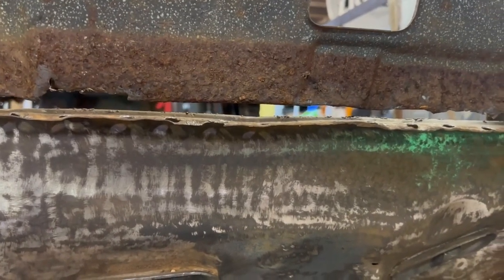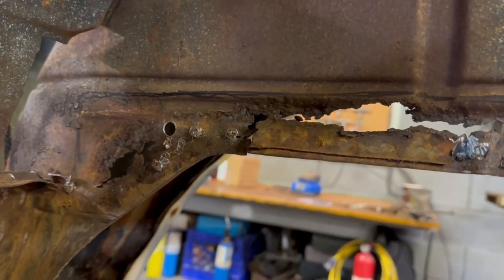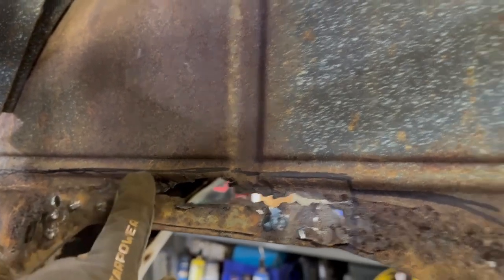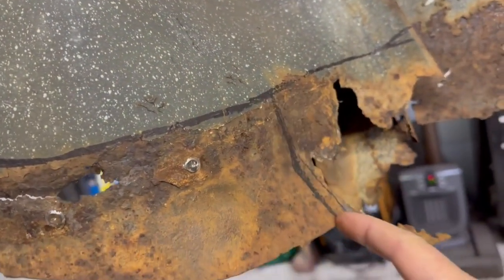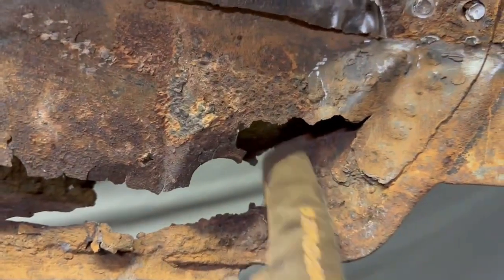That's step one. Then we get into the rear wheel wells. I'm really trying to save what I can here — bordering on automotive archaeology. You can see I've drawn a line here where I intend to cut. Each one of these will be a separate piece: I'll put a little curl in it and try to weld on that rib, then down here will be another piece, saving this, replacing all this, and then this part of the rear inner wheel well housing I'll have to fabricate.